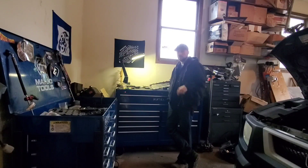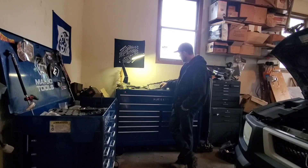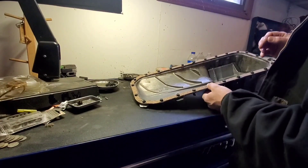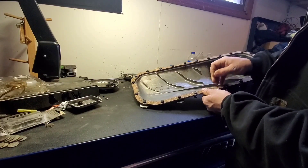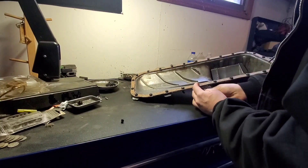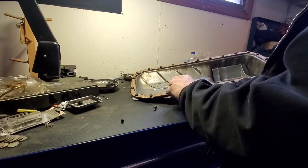Tomorrow — and tomorrow is today. We waited all night for the silicone to dry. We went ahead and placed the gasket and stuck the bolts in here upside down on purpose just to keep the holes aligned — we wanted everything perfectly aligned so that when we go to put our bolts up from underneath, we're not ripping our gasket up. Let me show you my method to the madness. First, we want to get all the bolts out. You can see we've got nice pretty holes going all the way through and everything's glued down — nothing's going to walk around, which I'll show you shortly is fairly important.